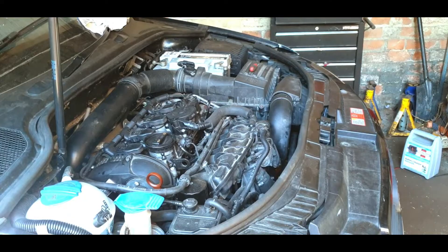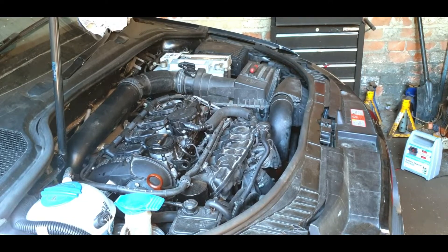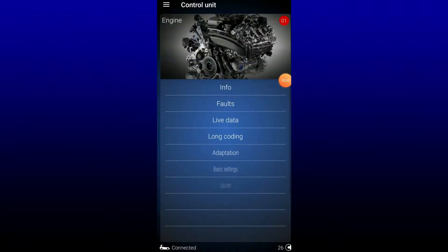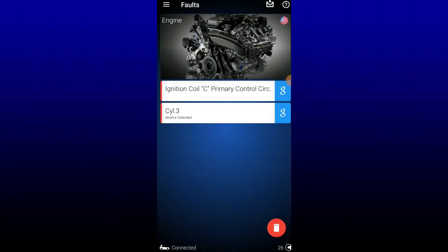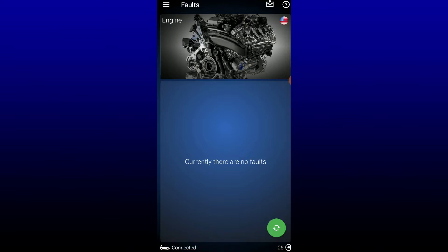So I put it onto the OBD and I could see it was cylinder 3. I removed this coil pack and swapped it over to cylinder 4. My one was cylinder 3 that was missing — it had a misfire detected. I swapped cylinders 3 and 4 and started it back up, but it was still shaking.